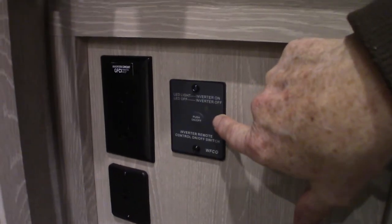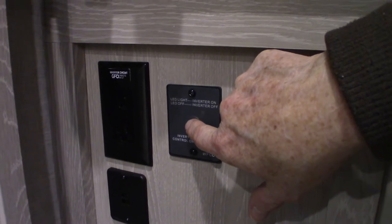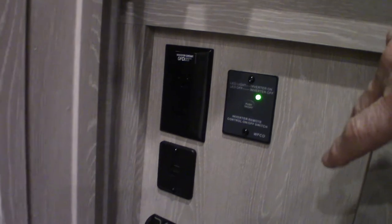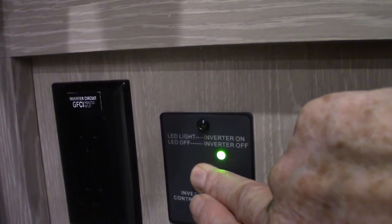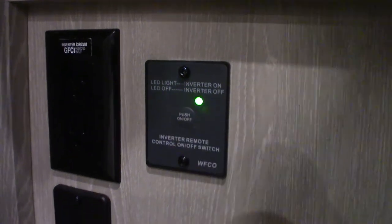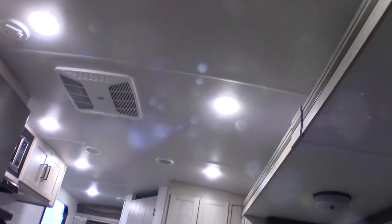When you're towing, your tow vehicle's alternator charges the batteries. When you're plugged in, this power converter charges them. For the inverter — you only invert power as needed, so don't just leave it running. Come over here: this button turns the inverter on to start converting 12-volt DC into 110 AC. This particular plug is the one wired to the inverter, so you have to plug into that to get inverted power. To shut the inverter off, hold the button for about five seconds. You cannot run the air conditioner or microwave on the inverter — only small appliances.